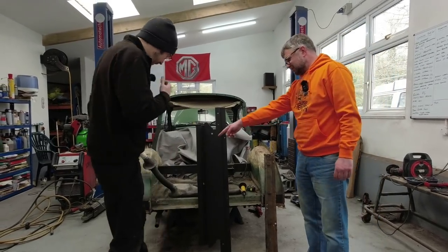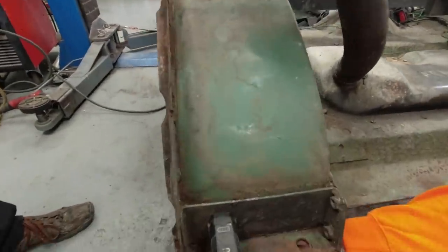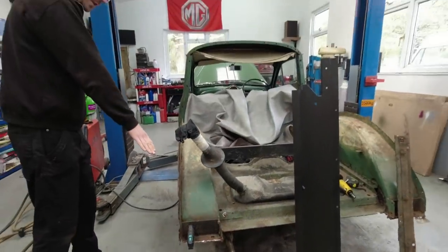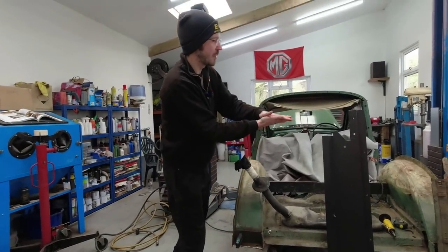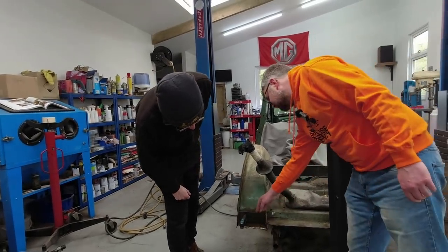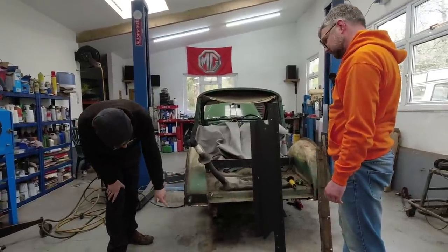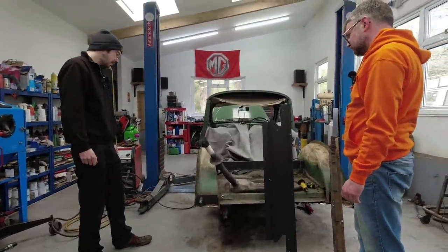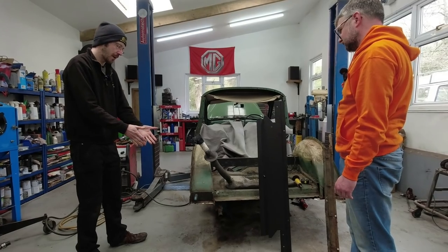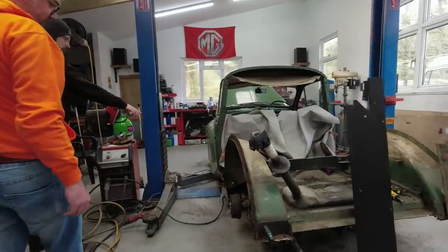There's daylight visible through the inner wing. This whole corner has caught it - it's the back of the wheel arch on the curb side, it tends to catch it the most. It's gone through the arch at the back and where the cross beam comes up underneath. There are lots of surfaces together and it's all just corroded through - lots of places for moisture to sit. It doesn't help with leaky windows as well. The process now is separating all the layers in this corner, finding where the good metal starts, cutting it back, and building the arch back up before starting on the cross panel.